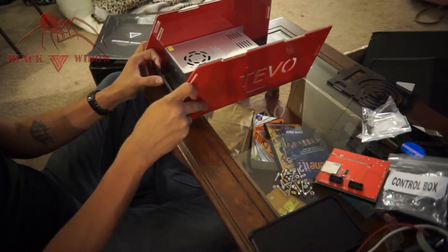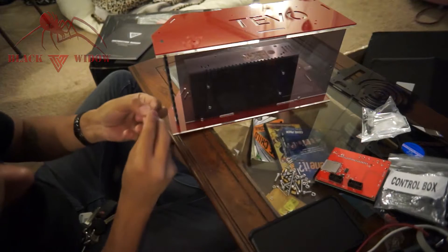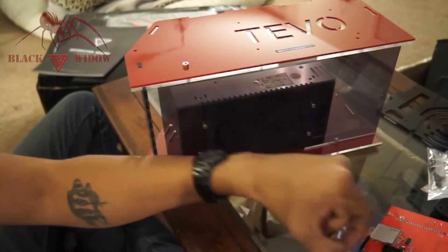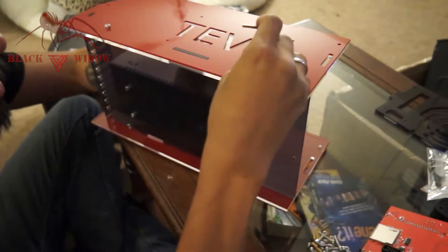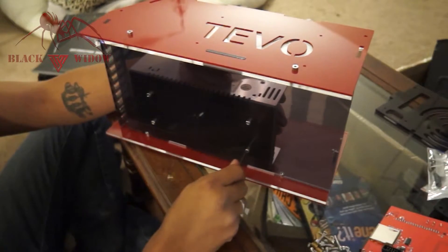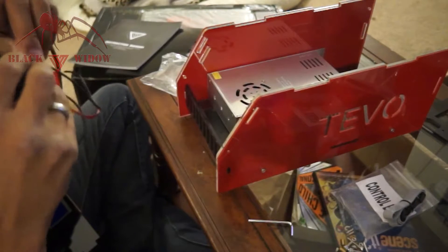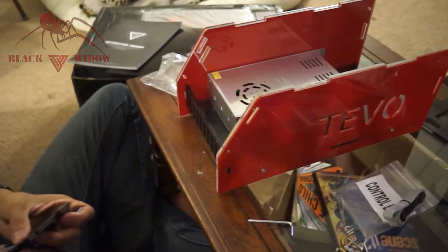The only part I'm going to attach to the bottom right now is the little vent on the bottom, because the rest on top you can fit together. Put the nuts through the little holes, put the bolt through, and tighten it — keeping them kind of loose though because you still have to get other components in there. Once you've got all the sides tightened you can finish tightening the power box from the bottom. Next we're installing the power button — keeping track of the wire colors: brown, blue, black. Pull the wires through to the front, then put the nut on.